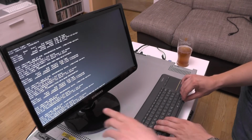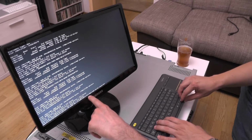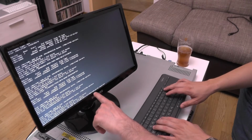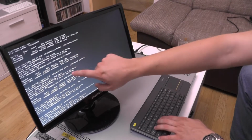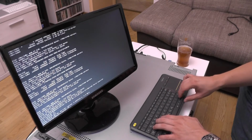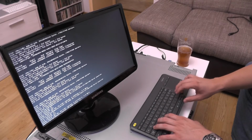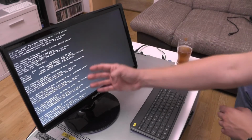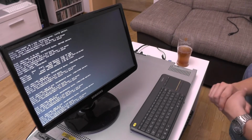So basically you're copying from /dev/zero, you're copying zeros. Yes. OF is the output, so this is the output device, which is the hard drive, right? Yes. Okay. And then I did E, D, and here are B and C, and I don't want to destroy my USB stick. So C and B, and yeah, that should give us 4 disks which are completely clean, so we should be good.